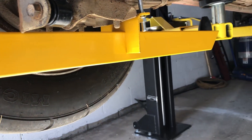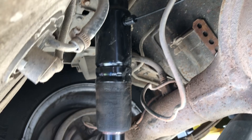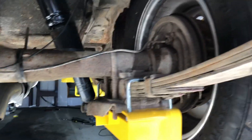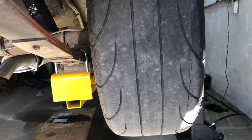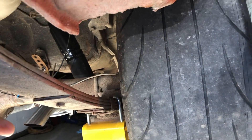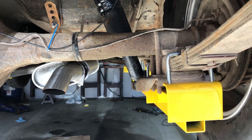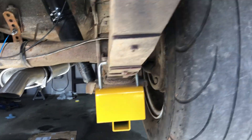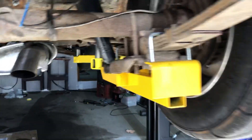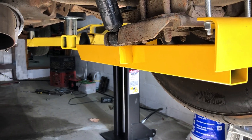You may have noticed I've also got air shocks on the back, because with these wide tires they rub. It's very hard to put a tire this size on the back of these cars with the standard suspension. I eventually would love to go to a four-link, but for now we're just going to run the factory suspension in the back. The air shocks just have a little bit of air in them so the wheel wells don't rub, and I have a feeling these traction bars may stiffen up the suspension a little bit also.